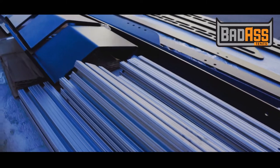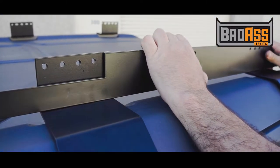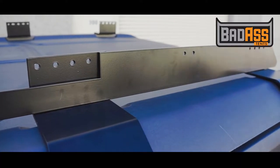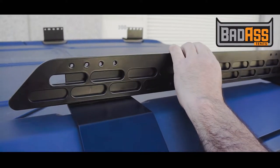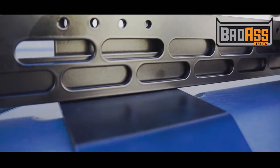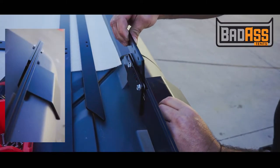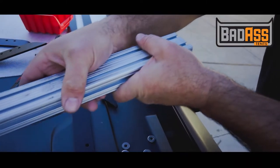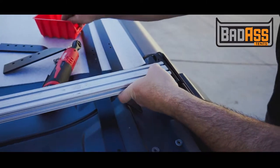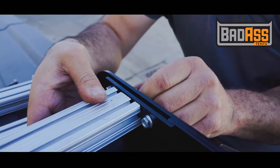The installation of your roof rack starts with the four brackets — the standoffs that clip into the rear section of the roof. There are two center brackets and two rearward brackets. Once you have the components up there, you'll start to thread through the fasteners. Use the 30mm fasteners to attach the crossbars, and the 20mm fasteners to attach the standoff to the side plates.